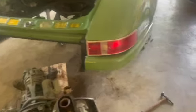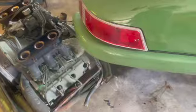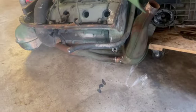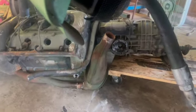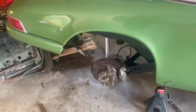in the oil. Our big problem today was this fitting that comes over here to the dry sump oil bag line, which is meant to be replaced. A little grease on the car, and that fitting between the oil bag and the line has a washer. It doesn't go aluminum to metal. Aluminum to metal is a bad combination, because the metal is going to weld and rust over time, and that's what happened here. I'm pretty sure this bag is metal. I've taken a couple of these apart and never fought that fight and destroyed the fitting before the line would come free. So we're going to have a new oil line, and that's just part of life when a car's been sitting 40 years, I suspect.